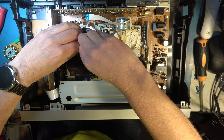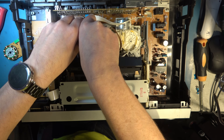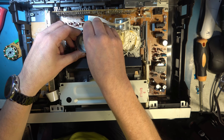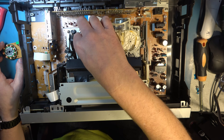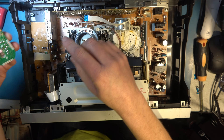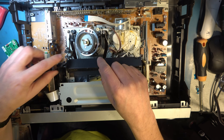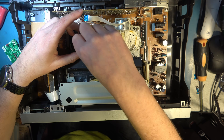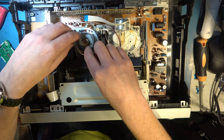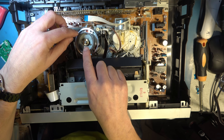Can I pull it right out to get some glue in behind it? No, it doesn't want to come out. You can sometimes take this magnet right off apparently, but not today. I'll just confirm the correct position by leaving it there temporarily. Hopefully it'll stay there long enough to test that we get a good picture with the magnet in that position and the drum and motor correctly assembled. I had previously slackened off a little grub screw to allow rotation of this collar, which sets the screw positions on the top part of the motor, so I need a small allen key to undo that and rotate it back to its proper position with the holes up and down.